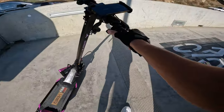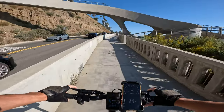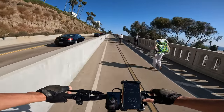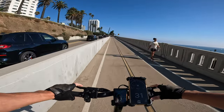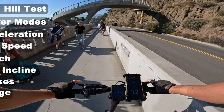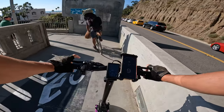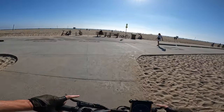At the bottom of the California incline, showing about 80 on the voltage. We have to ease off because we're already hitting 30 mph on the climb. This thing has serious torque. The regen brake kicks in at about 10 miles an hour — just pull either lever a little and it's a pretty strong regen. Below 10 mph it doesn't engage.